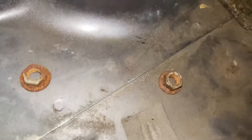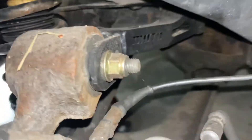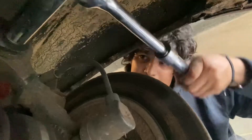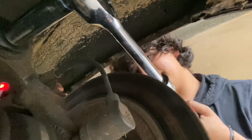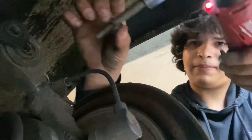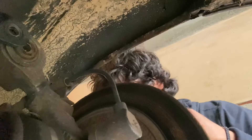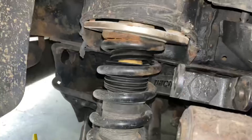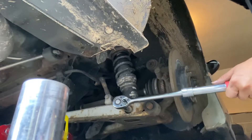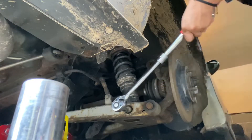I'm going to try to do this one by hand. They were loose already. That's awful. Both nuts are off. Next is this upper control arm. I'm going to start by undoing this big bolt. Get that anti-seize on it a while ago. Feels like it's not stuck. That coilover is rusty, but just got to undo that guy. The previous owner did anti-seize it.